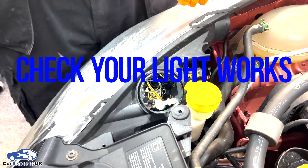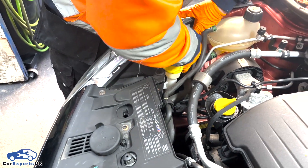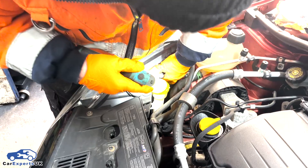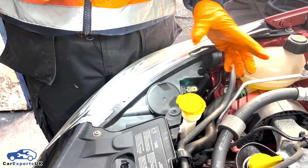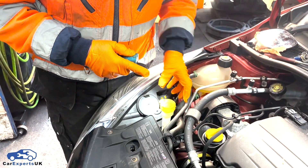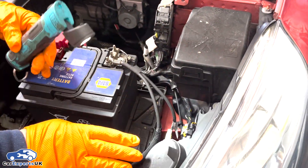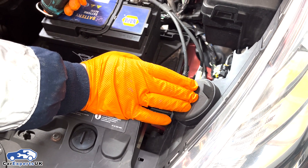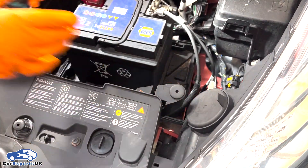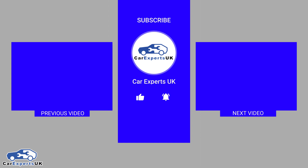Before you put everything back, have a check your light works. And then if that's okay, put all your covers back. It's important you put the covers back because you can get water inside the headlight or dirt, and you don't want water in your light. Sometimes you might have to move some components out of the way — sometimes you can take these out, they'll just twist and pull off. Sometimes there'll be an air box in the way. For example, on that side you've got a fuse box here, but this headlight is quite accessible. Generally, you can't get at things as easy as this — you wouldn't be able to see the bulb because it would be in the back and it doesn't have a side cover like this car's got.